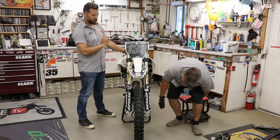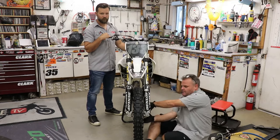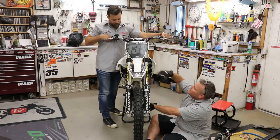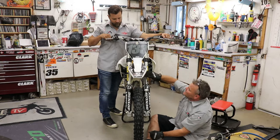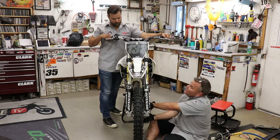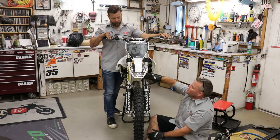So now at this point I put gloves on because it actually hurts your hands quite a bit. I sit down on the floor and I put my fingers on the back side of the rotor, and I push on the caliper - it pushes bubbles up. You can see the bubbles come up. No bubbles yet. Give it like three pumps until it gets there. My rule of thumb is if you can do it three times with no bubbles, usually you're good.